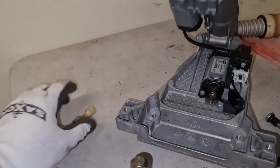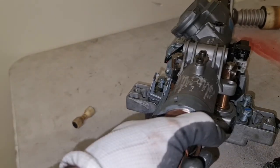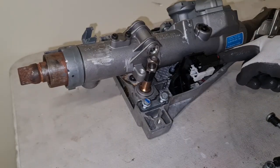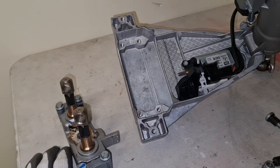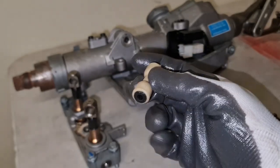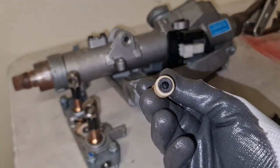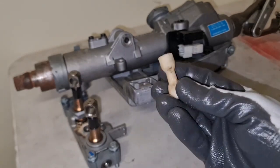Success! If this were on the car itself and you can't lift the column, you either have the choice to remove two bolts from the motor and push it back to access the flex, or you need to remove the gearbox, which is not going to be easy in that position. I was trying to look at this rubber flex and unfortunately I cannot find any part number, Mercedes logo, or marking on this part at all, so I cannot provide you the part number — hopefully you'll be able to find it yourself.